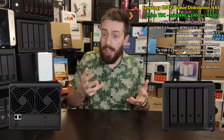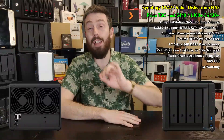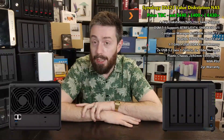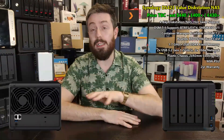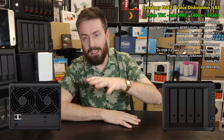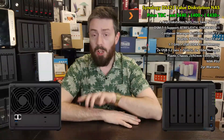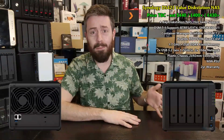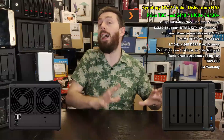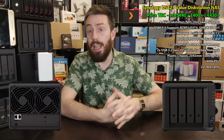Storage expandability is still incredibly limited. For USB connectivity, we don't have full confirmation whether it's two or three ports, but I think it'll be at least two USB 3.2 Gen 1 ports — so five gigabits per second, around 500 MB/s, which is a little disappointing but this is a value series. Another point that will be good and bad news for many of you: it is one GbE. None of us are surprised — Synology hasn't exactly been jumping through hoops to put greater-than-gigabit on all their systems.